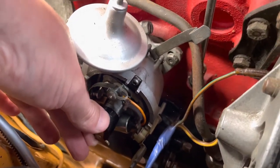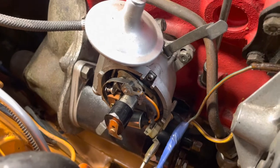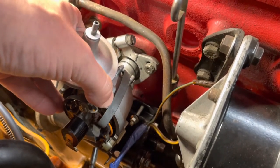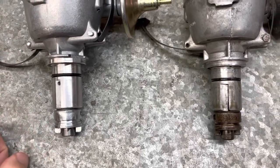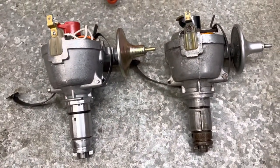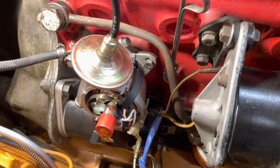There's a bit of slop — there's some play in the shaft both in-and-out and rotational — which is what makes me think this distributor might be causing some of the misfires. I've loosened off this bolt and the distributor slides straight out. Here's a side-by-side comparison of the two distributors — they seem really close. I'm going to take some measurements to check the diameters and lengths to make sure I haven't missed anything. I'll line up the cheap distributor as close as I can get it to how the previous one was, put the cap back on, connect the plugs, and try to start the car.